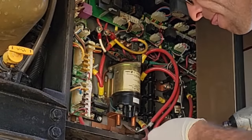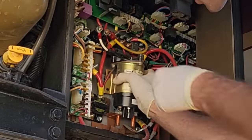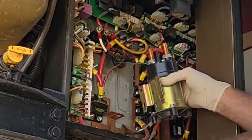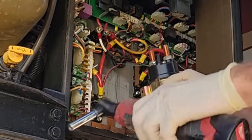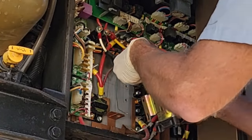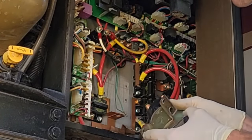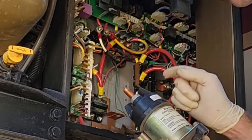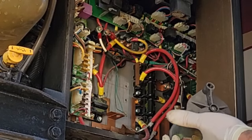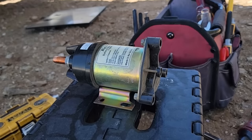Do be careful — we do have the batteries disconnected. Let's go ahead and pull it up out of those brackets down there to give me access to this last nut. This is for the low-voltage coil that controls this — it uses low current to make a little magnet to pull a plunger down and connect the two batteries together, basically like any relay would work.